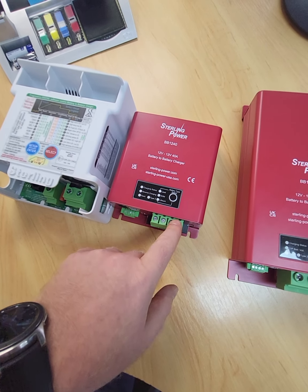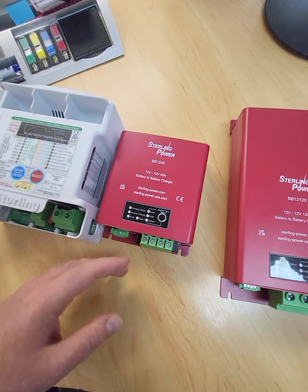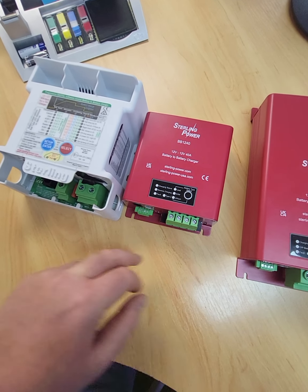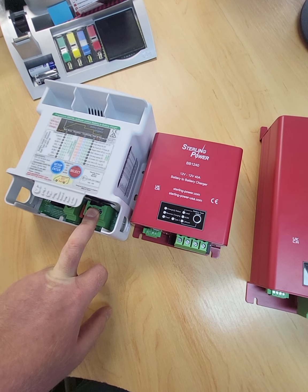Typically these things actually work under bucking circumstances because your alternator's voltage is often higher than that of the battery you're charging up, so it's actually dropping the voltage. Then eventually the output voltage will climb up to parity between input and output. So 550 watts here and about 630 watts on the output of the BB1260.